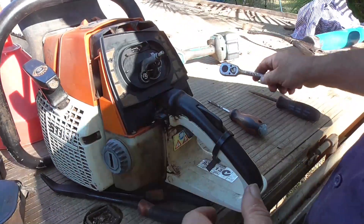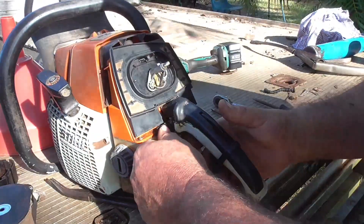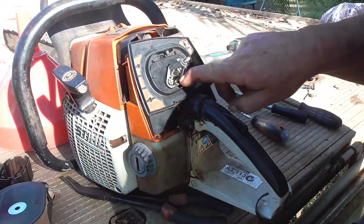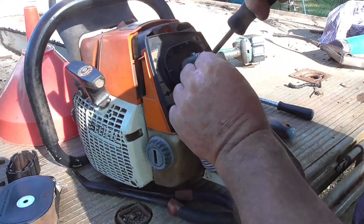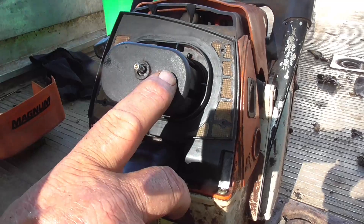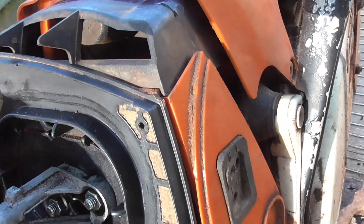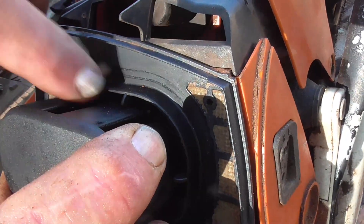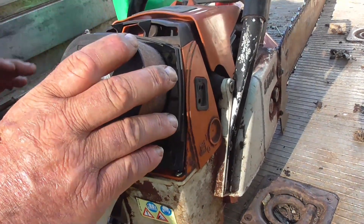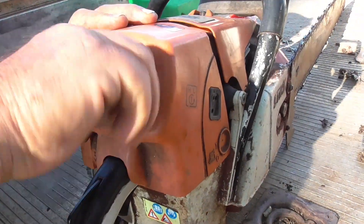Don't over tighten these — they've got to be tight but not ridiculous. Now I'll just check all the controls work — yes they do, choke all works. Yep, everything works properly. The only thing is I can see just in here a little bit of dirt that I've missed so I'll just get in there and wipe that out. When you put this bit here on just be very careful that it's the correct way up — it's not hard to try and put it on upside down. This hole here has to be open up the top, so if you've got it on the wrong way up that hole would be covered up. Put your filter on, screw the back of your cover on then.